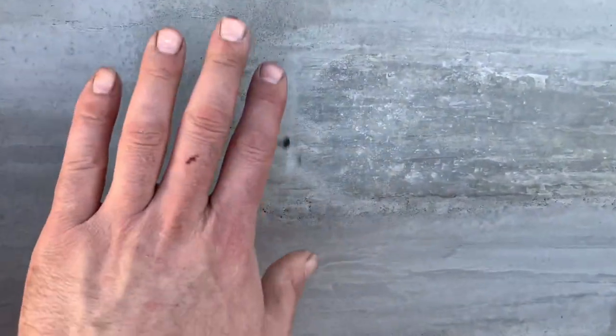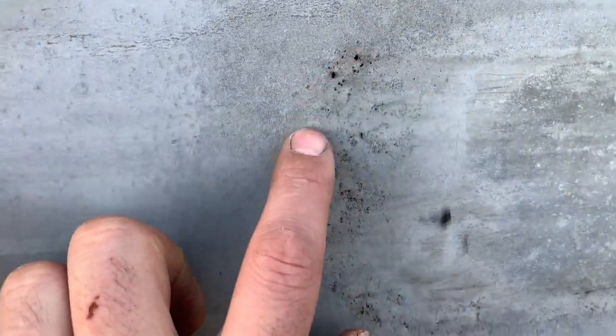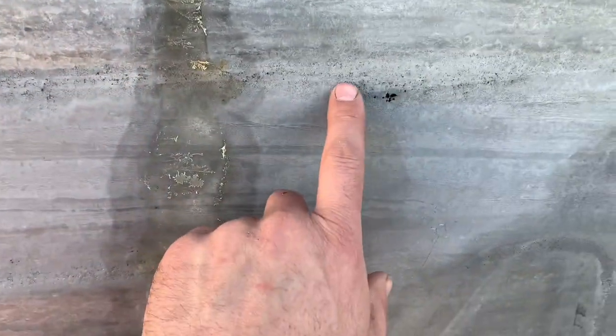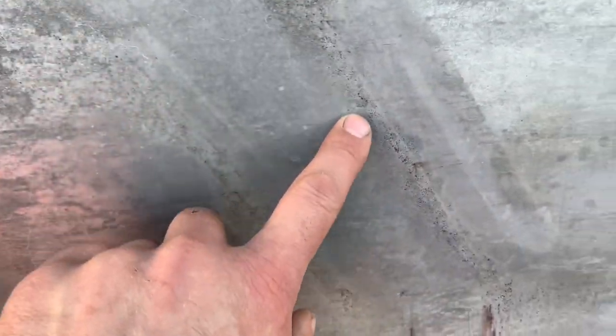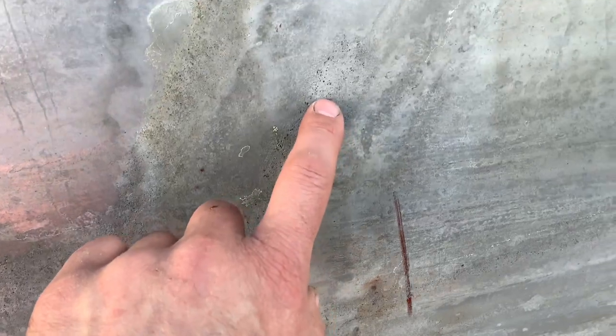The reason I cut it apart was because we have all this rust festering between the two layers, and there are actually little holes clear through to the top side. If you didn't get to it in here, it's always going to rust back through the top side. There are no skins available for this, so I thought this was the best way to do it. Even through that real hole, the bracing had those little tiny pits, and every once in a while one of those pits pokes all the way through to the top side.